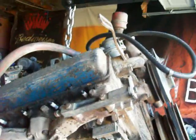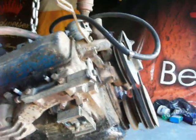One thing I noticed as I was cleaning — something I thought I saw when we first got it while I was playing with the starter — is that freeze plug right there is leaking. We've got coolant coming out of it. I thought I saw it when I was under here working on it, but I wasn't 100% sure. Now that I've got it out and have a good look at it, I know it's leaking for sure. So it's a good thing we pulled the motor — it'll be easy to replace all the freeze plugs.